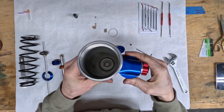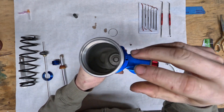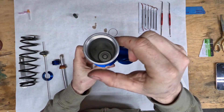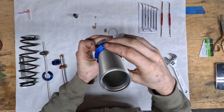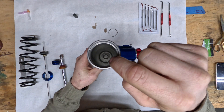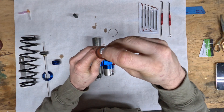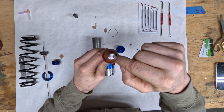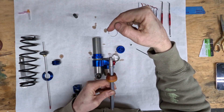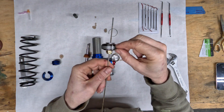Looking down the cylinder, around this level you can see six holes all around — those are your ports for the adjustment of your high and low speed. These shocks do not have needles. On some shocks you can look down and there'll be a needle sticking straight up, which goes through the hollow shaft to change the porting for your adjustments, allowing it to be super soft at low end. As the shock slides up the needle, it fills some of those holes, forcing oil through your dampener.